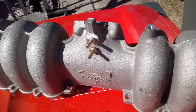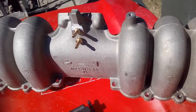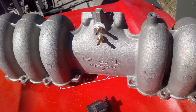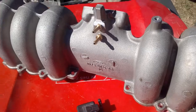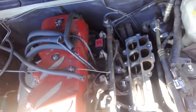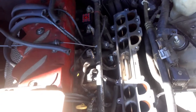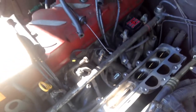I've got a whole heap of different variations of those bleed valves — whether I need one, two, or some larger ones. I've got plenty to work with, so that's going to be trial and error. At the moment the engine's theoretically making about 200 kilowatts — it's making about 158 at the treads. On dyno day next week we may be able to crack 165 to 170 at the treads. We'll see what this stock motor is capable of — it's basically a stock head and stock manifold, just got a cam in.